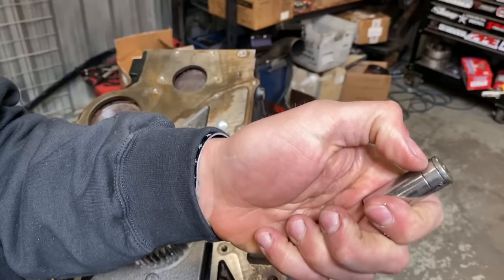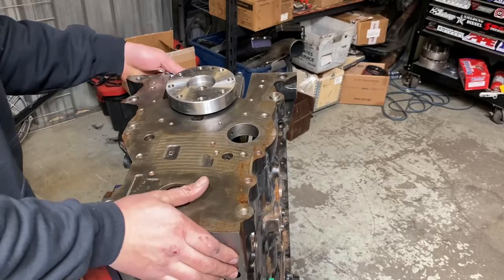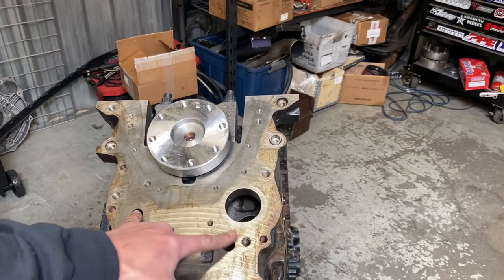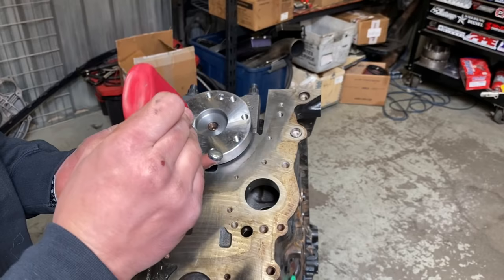We'll go ahead and knock out the, this thing apparently needs some grease. Can you guys still see here? So we'll go ahead and knock out these two right here. Same size freeze plug. And basically we're just gonna repeat the process here with the 640 Loctite and the hammer followed by the socket. We'll go ahead, grab the other one.